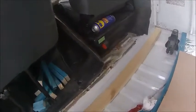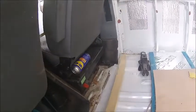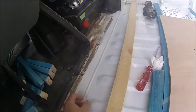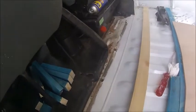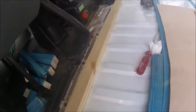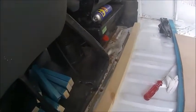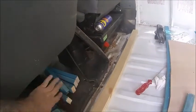This problem I've got at the front — you see where the van ends, there, that big bit there. The problem with putting the batten right across there is these ridges. It's really hard — I'd have to put a very thin, tall batten and it just wouldn't be stable. So what I've done, I've routed out the piece of timber. Because of this joint that's raised, I've had to router out this piece of timber and this piece of timber sits over that raised bit there, which brings it up level with the battens in the floor. So I'll take the floor up to the edge of that, and the cab side I'll be treating as completely separate to the back.